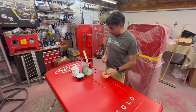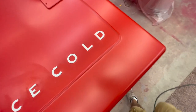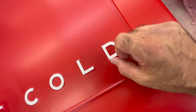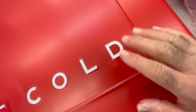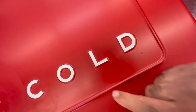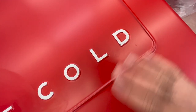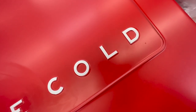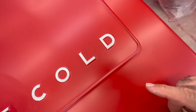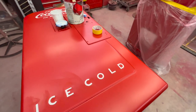I'm going to turn the camera around here. We've got a couple of letters here that have a couple of little things I'll show you. I'll get a little closer so you can see it. As you can see, when I'm pulling up the vinyl I'm trying to get an edge started, and that base coat underneath is really soft and sensitive until it gets a clear coat put on it. You need to get the base on there and get that vinyl off the next day. My apologies for this, but I think it's good to show what you can do with a couple little spots like this — I'm going to show how to do a little bit of repair and clean those up.